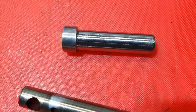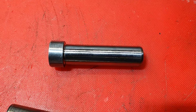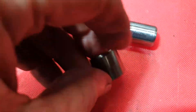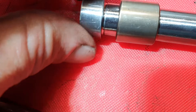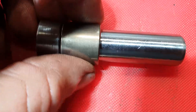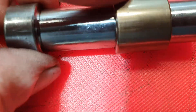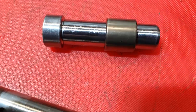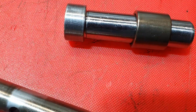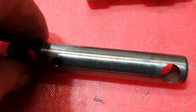This is the little tool I made many years ago — I had to refresh it on a lathe a few years ago because I'd been using it as a drift, which I don't do anymore. These bearings come with a little packer so the needle rollers can't fall out. You push it through and it retains the needle roller. Note that I've actually put it on backwards here — the rolled end should be facing the other way. You use a press or a vice to push it through, one from each side. This end is slightly smaller than the inside diameter of a rocker so you can also push it through to push the old needle rollers out.